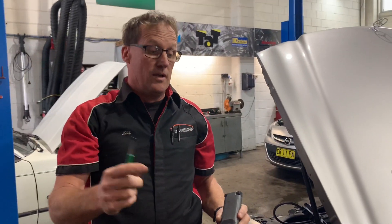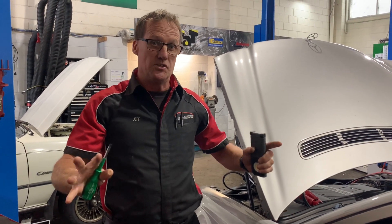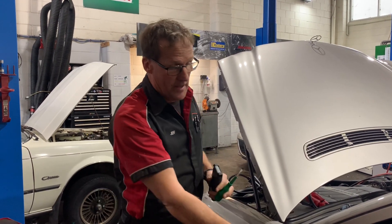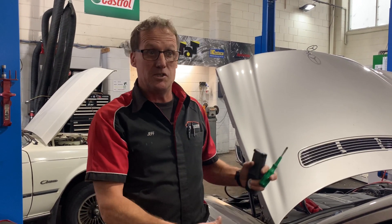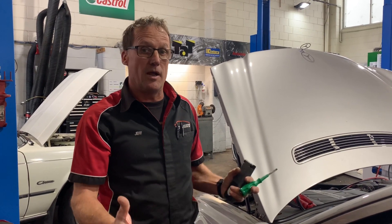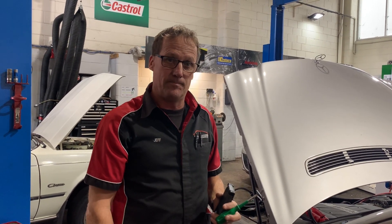So with our scan tool, we haven't pulled too much apart and we've been able to diagnose these problems. Don't forget actuations with your scan tool — most modern scan tools now allow you to go into these modules and actually turn on or off indicator lights, mirrors in/out, mirrors up/down, door lights, windows, and so on. So if you've got a problem in a door, a tailgate, or whatever, find the module and use your actuations and live data to determine what's working and what's not. Hopefully that's helped you out, guys. See you next time.